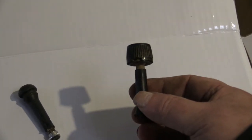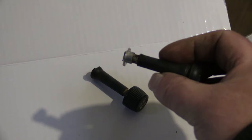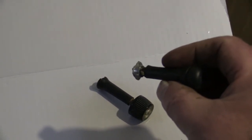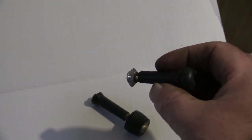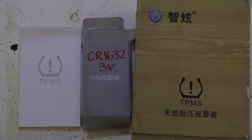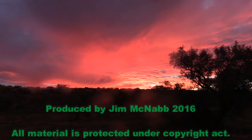The downside of these particular ones I've bought — this is the valve stem with the sensor on it. We had to cut the valve stem out of the car to get the sensors off. As you can see, the sensor's internal parts are made of aluminium, and aluminium screwed onto brass will cause electrolysis. In Australia we've got a lot of salt lakes and high salt concentration on the surface, and we're constantly immersing our wheels in and out of salt, so they weld on. Here's the brand — avoid it like the plague. Don't buy any that have aluminium inserts.